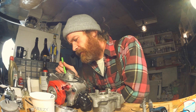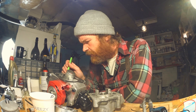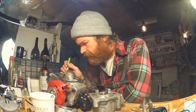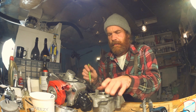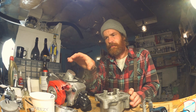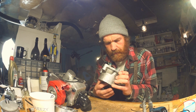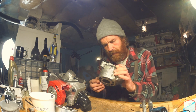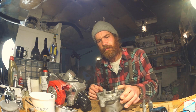Checking with a magnet, it doesn't seem like that black-gray goo is steel, so probably aluminium — probably the plating and the piston. I know Mark changed his pistons; he's running kind of the same design. I know he changed the taper — I think the taper was too steep — and this might be the case in my case too, but mostly it's my plating, which we're going to do something about now.